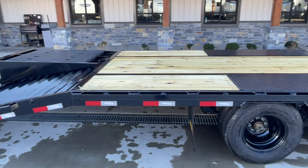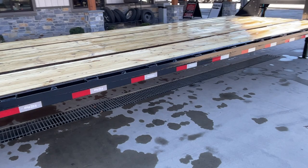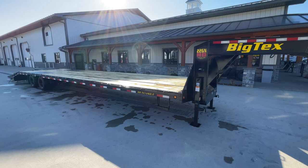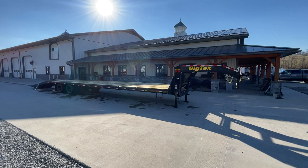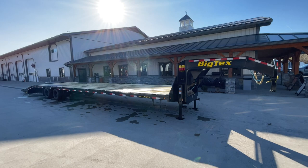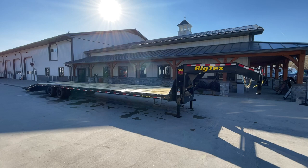To recap: this is a 48-inch spread axle with mud flaps and reflector tape down the sides. It's a 12-inch I-beam frame with a torque tube for extra rigidity, and 16-inch on-center structural channel crossmembers — not formed steel. It weighs about 8,000 pounds. You can get this in different lengths — 30 plus 5, 25 plus 5, and the 35 plus 5 shown here — with 10k, 12k, or 15,000-pound axles. We stock about 1,300 units including used inventory. Check us out at bestchoicetrailers.com or call 717-220-4220.